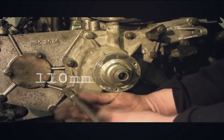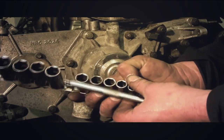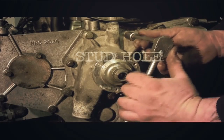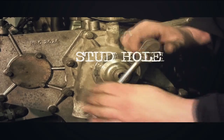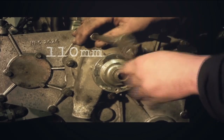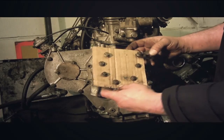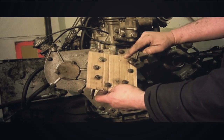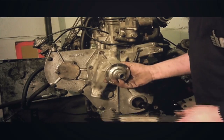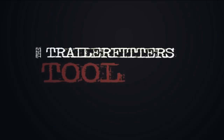This one's 110 millimeters, which goes right the way through to the cylinder block. The stud at the top has a 13mm nut on it, M8. There are torque settings for these when you do them back up. The 110mm bolt pulls the casing and everything together — it's important to get the length right. I've put them on a piece of card to keep them in order. To break the seal, I've used a soft-headed mallet just to crack it off the gasket. So now you have the water pump off.